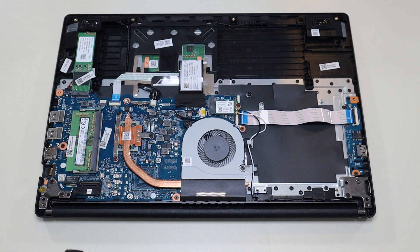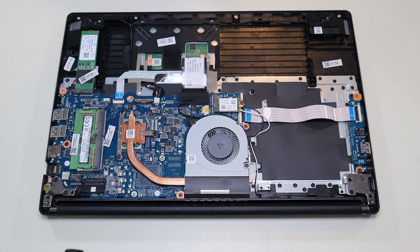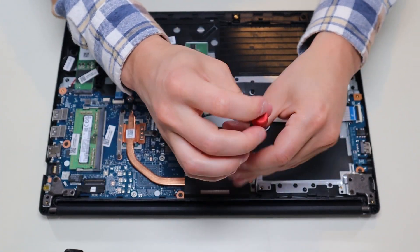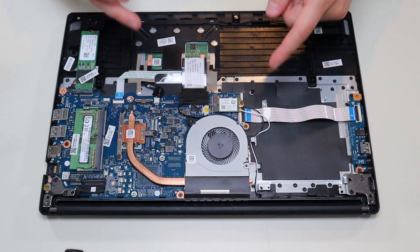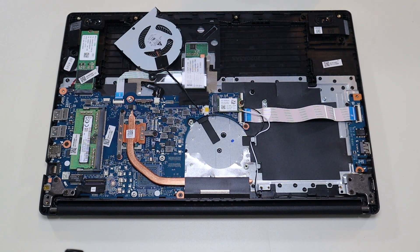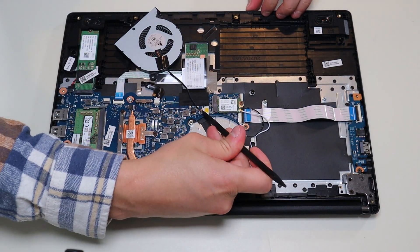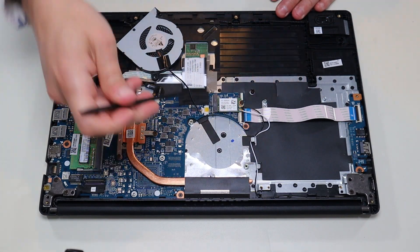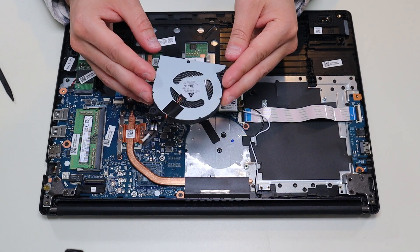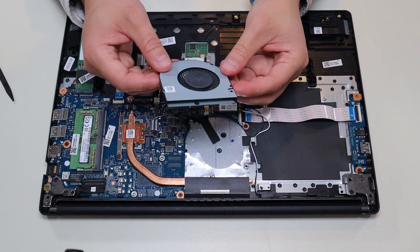Now that the battery has been removed or at least unplugged, it's safe to proceed deeper into the computer. This is your fan and your heat sink assembly here over your CPU. To get the fan out, I'll take out these two screws. The fan releases independent of the heat sink assembly, but it does plug into the motherboard, so don't just rip it off. It plugs into the motherboard right there — just like the battery, there are grips on either side of that plug. I can take my fingernails or a pry tool and push a little on each side until I wiggle that out. So that's your fan — I'll try to have a replacement fan option below in the description. If you're here because your computer is overheating or trying to clean it, you can access this fan now — vacuum it out, blow it out really good.